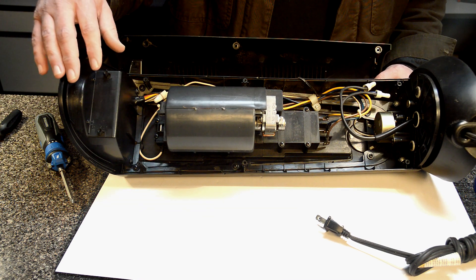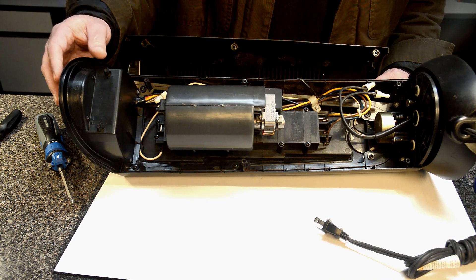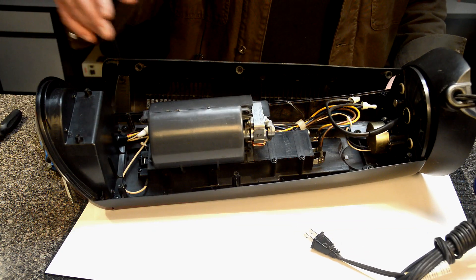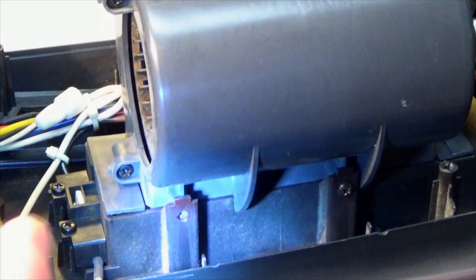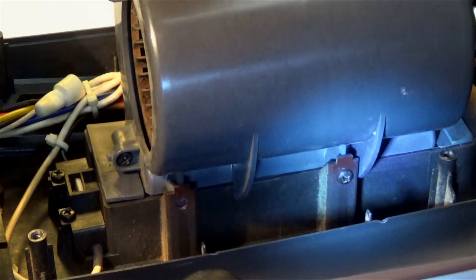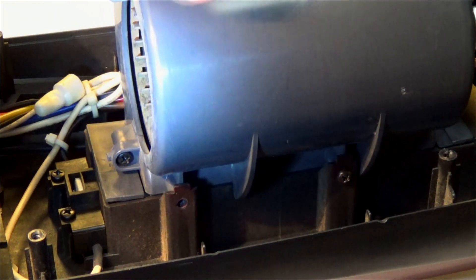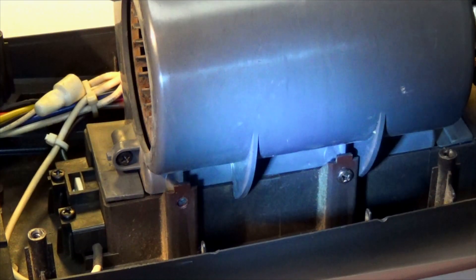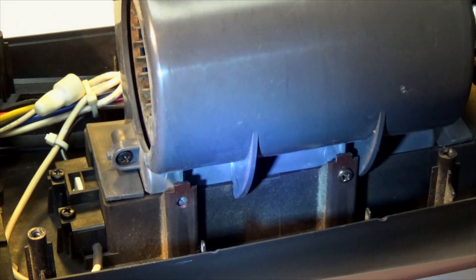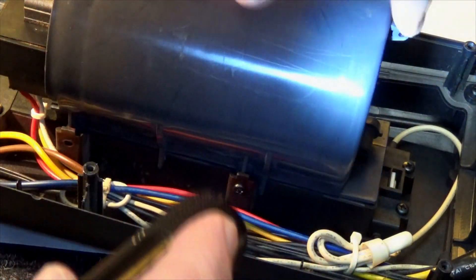After you clean this out, you could actually snap it back together, but I recommend going deeper inside the blower and the heater core — we can make it a lot better and foolproof, like it was new. But that's up to you. If you're getting intimidated, you better stop. Down here on the fan, you just have to see how it's built. You can see there was a hole there and a screw there. There are also screws in the shroud, but that takes us apart, which we'll do later. For now, I just want to get the fan off the mechanism. Just look and see what screws you need to take out. On this side, there's a screw missing there and there's a screw there — that's the other side of the clamshell.